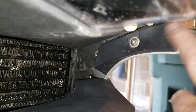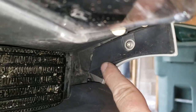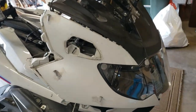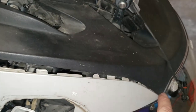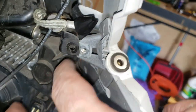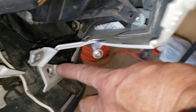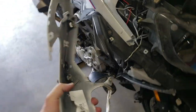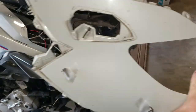For the side panel, there's a screw here and this plastic piece comes with that screw. What you don't see if you're not careful is there's another screw behind it. With the mirror off, we can gently loosen these clips. There's going to be a mounting bolt screw here, one here, one here, and two in here. Once that's done, it just unclips and slides forward.